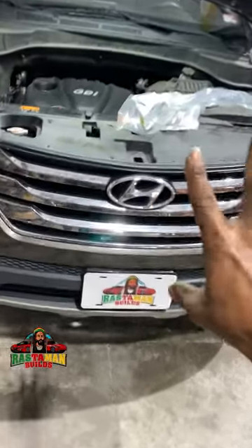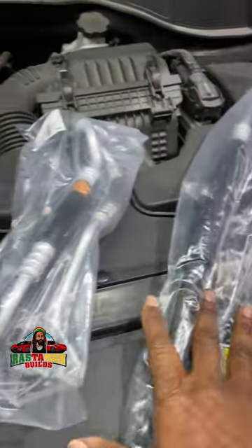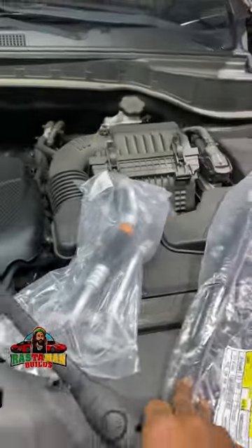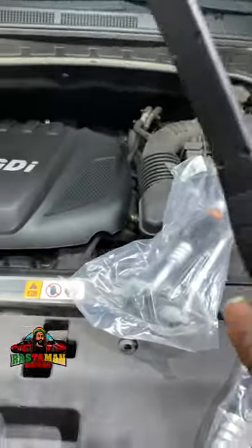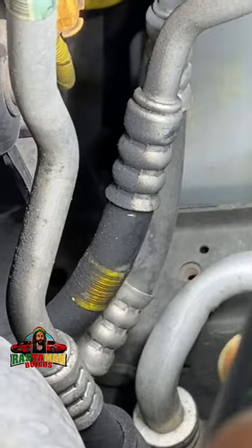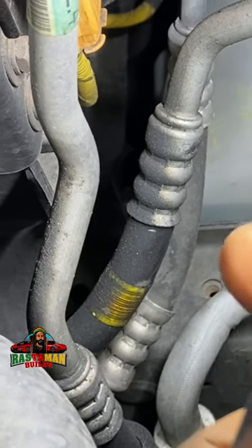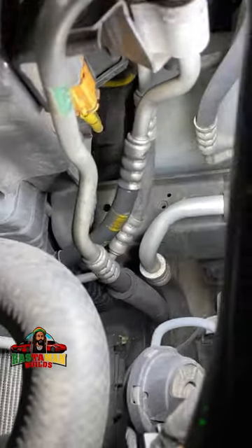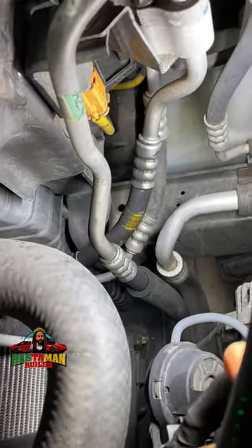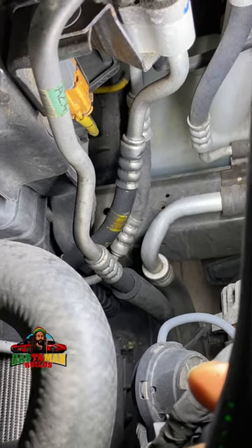It's a little bit early in the season, but some people are getting a jump on it. We are doing AC lines. Customer states they put refrigerant in and it doesn't last the whole season. So they have a leak and they want to check for it. When I start looking around for the leak, look what I found — you see that oil on the line right there? The line is leaking at the clamp. It's coming out onto the line, soiling it with oil.